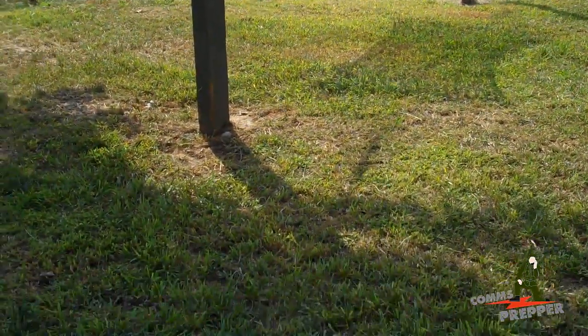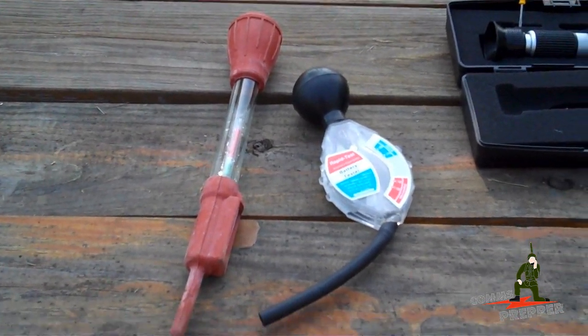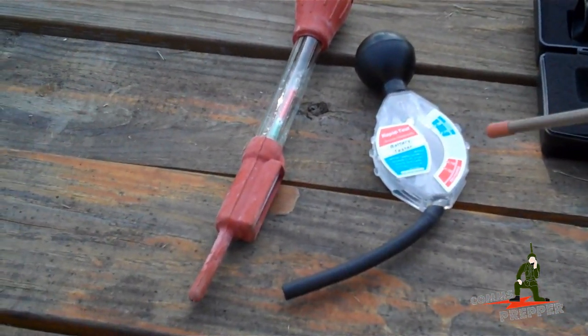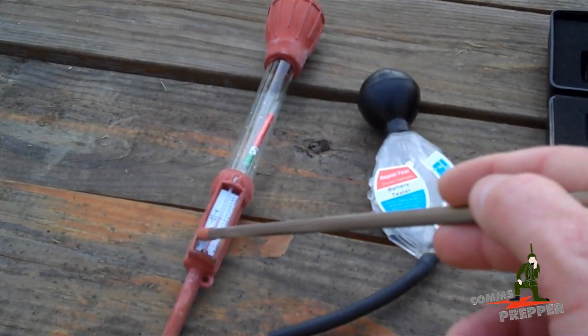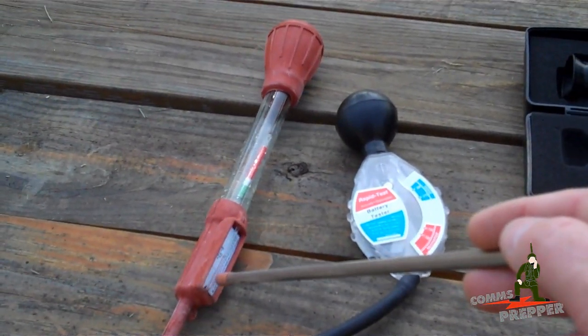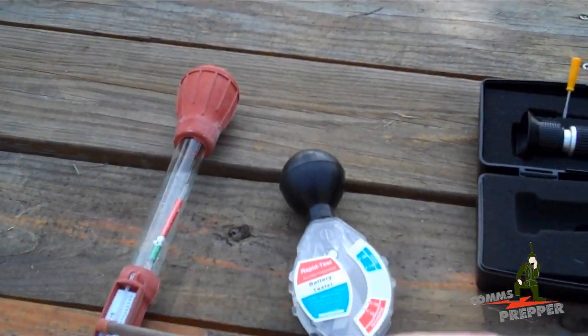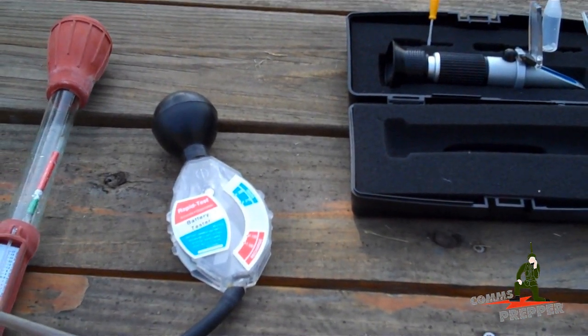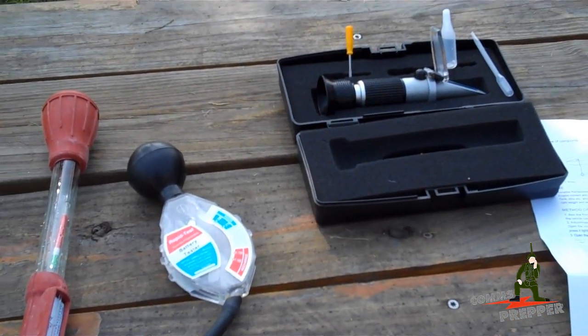In the past when I've done this, I've shown these hydrometers. I have two — one I bought locally at the auto parts store, and one I ordered off Amazon because it had a temperature compensation scale. But I've never been really confident in the readings because there are stickers placed either on the float or on the device itself, so the calibration was always suspect, and the feel wasn't quite right.